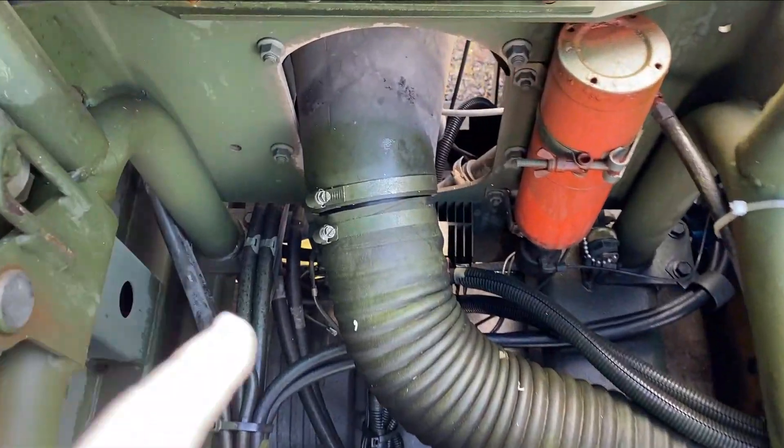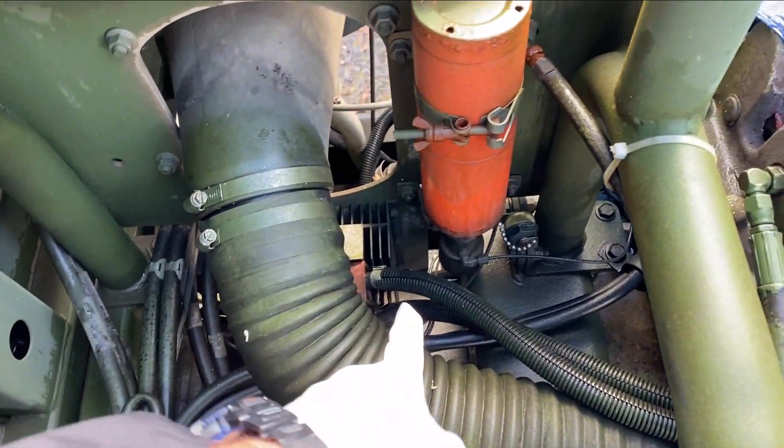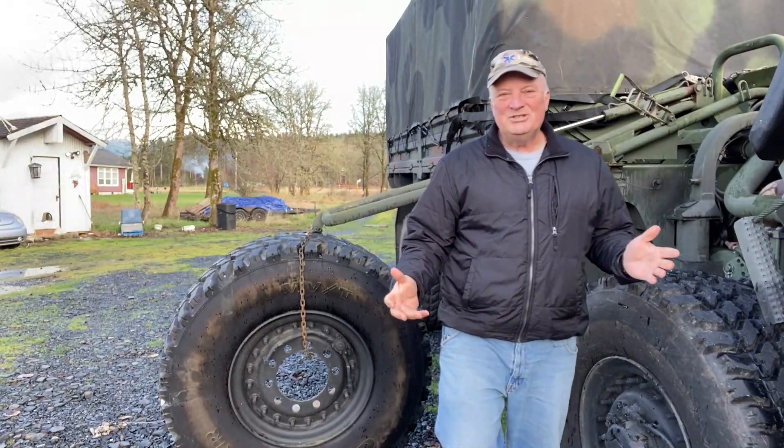I'm standing where the spare tire would be. First thing I'm going to do is remove this clamp here so I can move this out of the way — because there's the power distribution block right there. Fortunately, the power distribution block looks like it is in great shape. I refurbed it about a year ago and I have a video on that. Just search my channel for 'power distribution block' and you'll find it. I would really recommend doing that because it is just a corrosion nightmare — get all that corrosion cleaned up and you'll have no problems with your batteries. That ensures I won't have any problems when I go to put my batteries in and get that battery equalizer in.